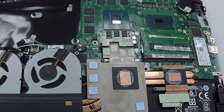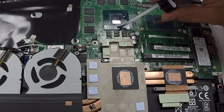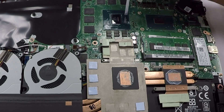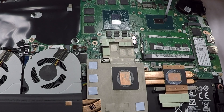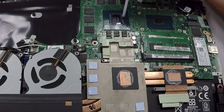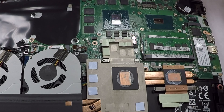Once you've cleaned off the GPU and CPU chip, take conformal coating and apply several layers on the GPU and CPU boards. Make sure you give each layer a few minutes to dry so that you can ensure you have several layers of conformal coating to protect the chips. Liquid metal is conductive, so you want to make sure that if liquid metal moves, the conformal coating will have an adequate barrier to protect your GPU or CPU. Be patient and work the conformal coating all around until you feel you have enough layers.